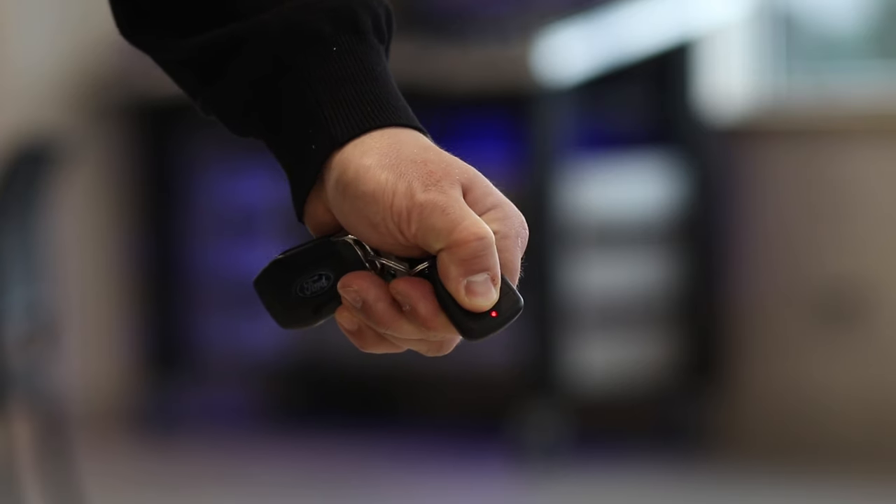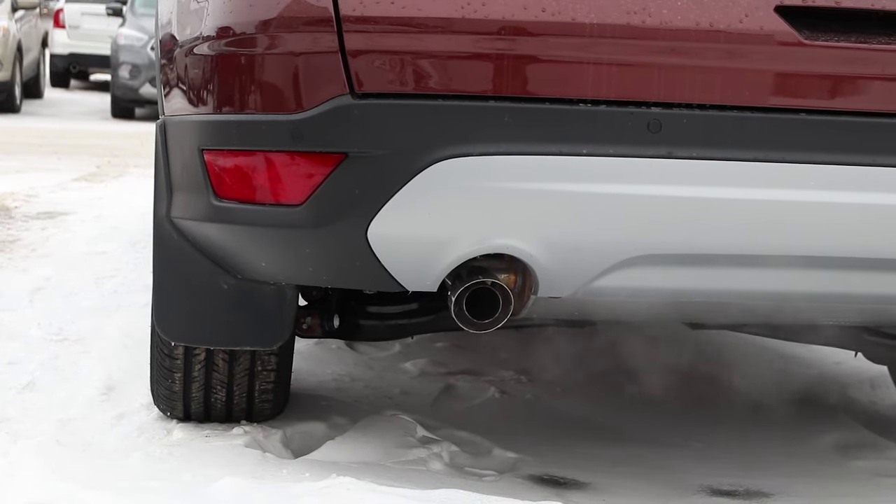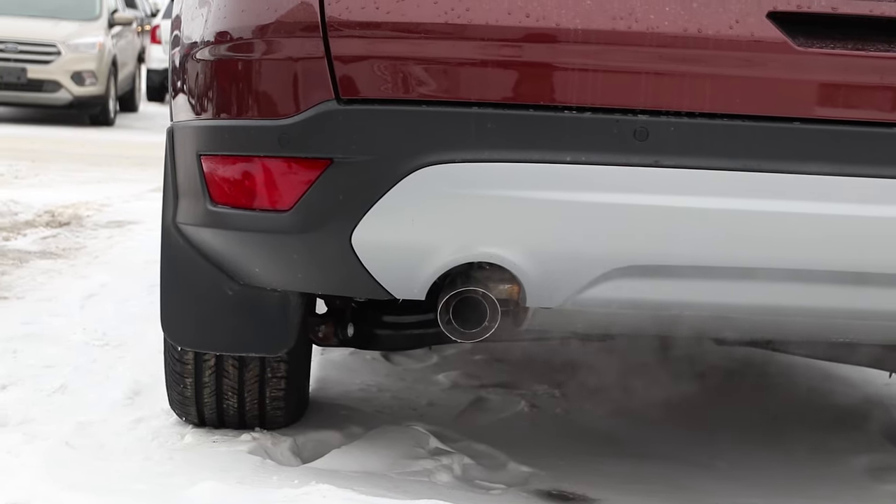I know it's not good to leave your car running for 10–15 minutes, but I think you're crazy if you don't warm up your car when it's minus 40. When your engine is already warm from your block heater being plugged in, it's gonna use less gas while idling and it's gonna heat up your cab a lot faster — so you don't have to idle as long.